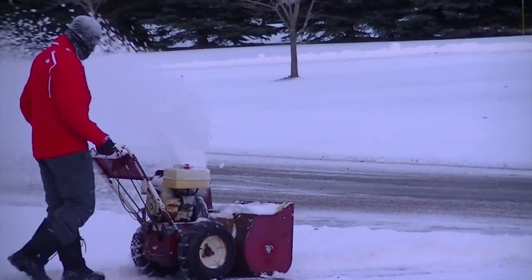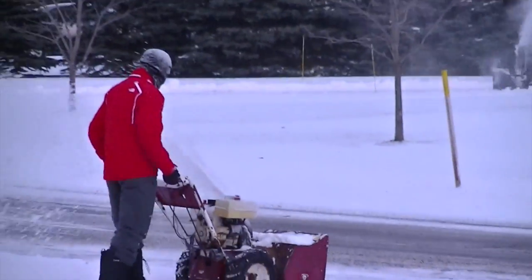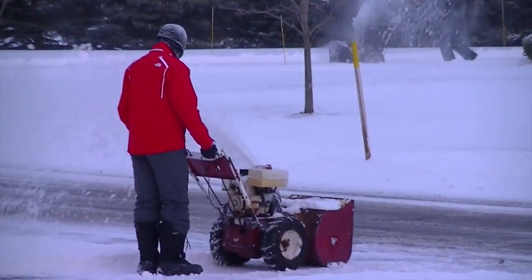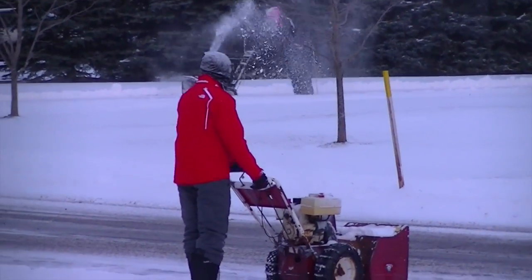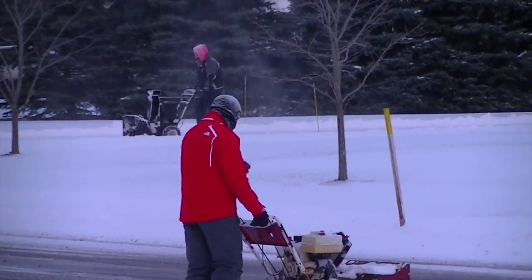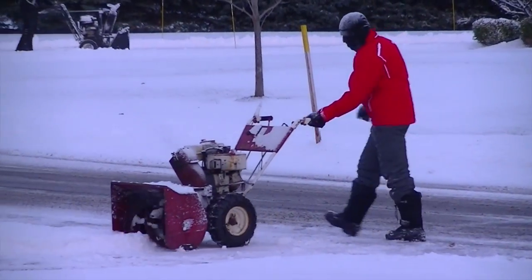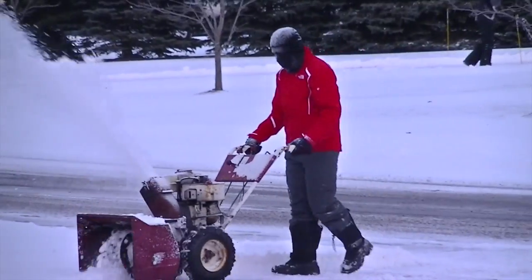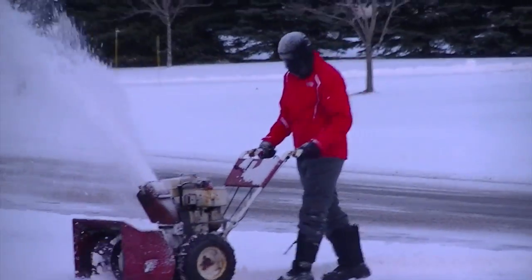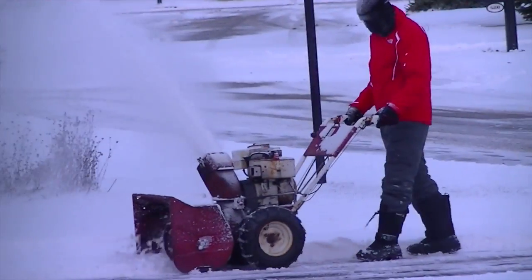This has really been a nice blower. I purchased a carburetor kit and never wound up using it — I only paid $7 or $8 for it. I just tried to get all the parts clean and I did. This thing fires up on the first pull no matter how cold it is. My plan is that once spring comes, I'll tear into it. I've seen some stickers and decals on eBay for the Tecumseh motor as well as the Snapper housing, so I'll be putting those on there and we'll get it looking real nice and fresh, but it does a great job.